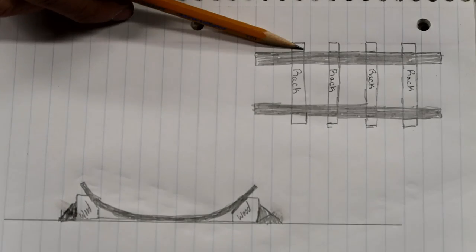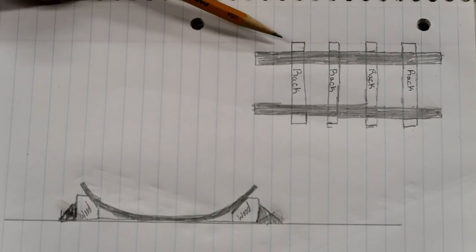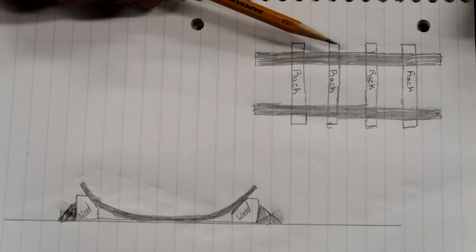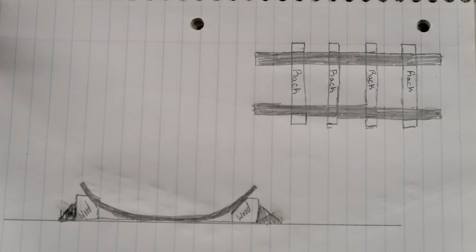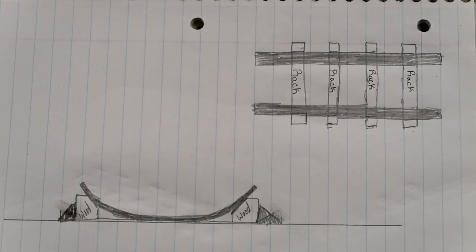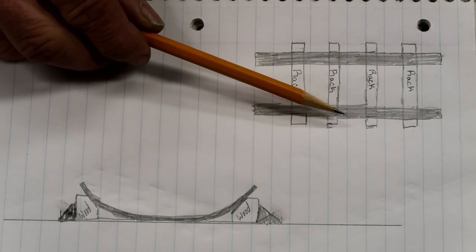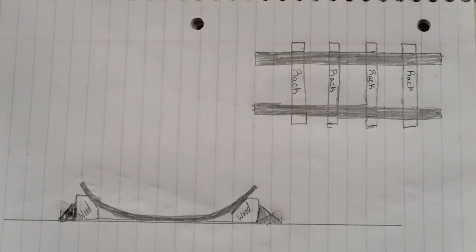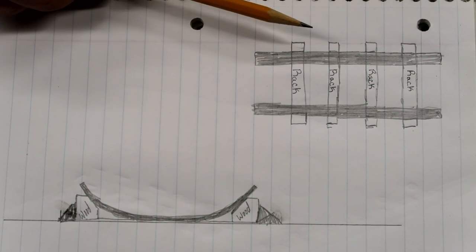Here are two illustrations — one from the top, one from the side. First things first: if you know how wide the coil is going to be, you need to lay out your coil racks. Your first two equal 10,000 pounds, the third one adds another 10,000 for 20,000, and another gives you 30,000, and so forth. Depending on how heavy the coil is, you need to add enough coil racks to keep it secure on the trailer.